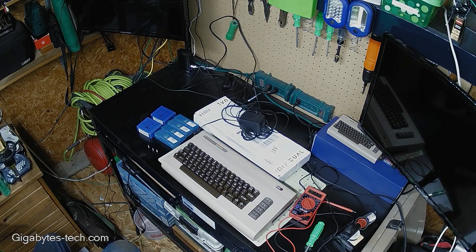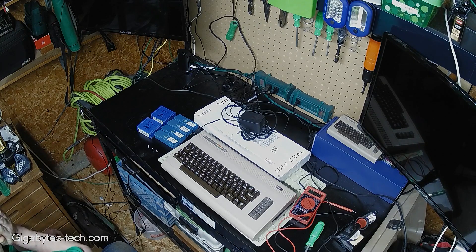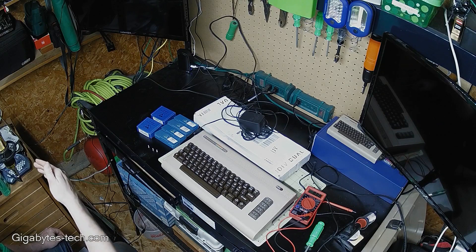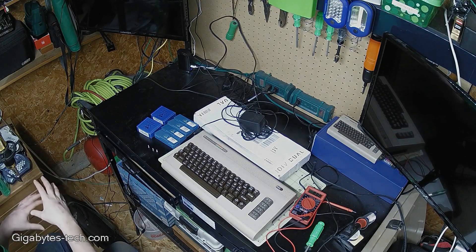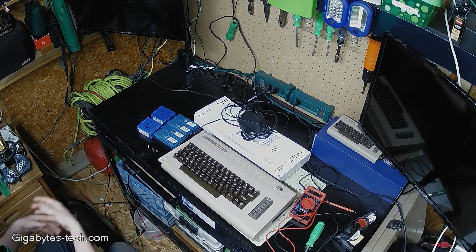What we're doing today is — on one of my last videos, the video where we made the composite video cable, I discovered there were other problems with my Commodore 64, in particular with the video. It related back to a frequency crystal, the Channel 3 frequency crystal specifically, and possibly the VIC-2, and possibly it needs a recap. The original plan was to repair the board, get it all nice and wonderfully functioning, and pull it out and replace it with the Individual Computers C64 Reloaded Mark II.